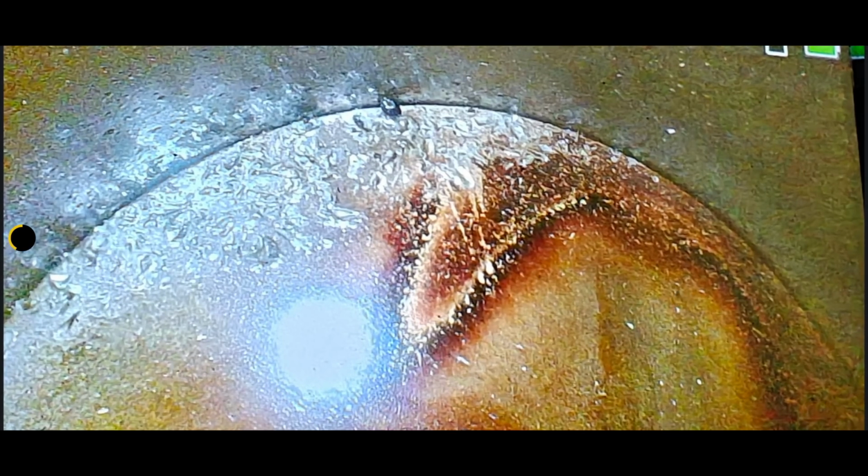And then what they ended up telling me was, when they took the intake off, because I guess they replaced the knock sensors in this trying to fix the misfire, not sure why, they said the intake was filled with this white powder. They said it felt like teeth filings, and it must have been from all the spark plug material. Must have blew up through the intake valve into the intake. They said they had no idea where this came from.